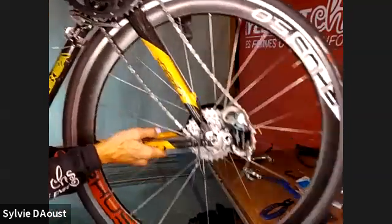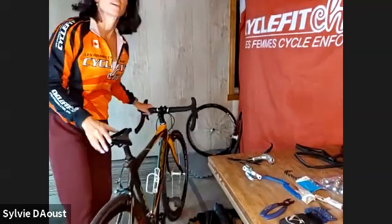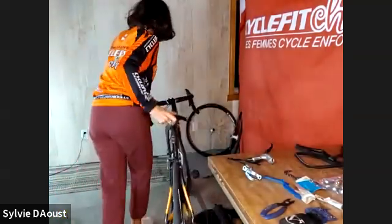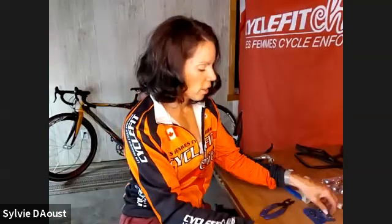Now, there was one time I was at an event. It was like a century ride. And I took a look at my chain and I noticed one of my links was kind of bent. I was like, wow, I don't know how that would have happened, but it did somehow. I'm just going to keep my eye on it. Sure enough, 50 feet after we left, it broke. It took me like 5 minutes to fix. I just took out the defective link and I replaced it with a good link that I had with me.